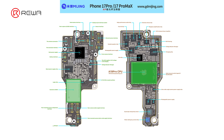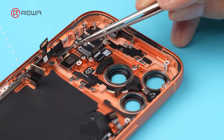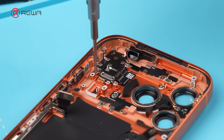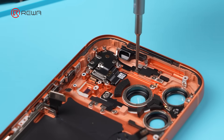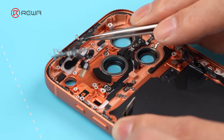The NAND is closer to the A19 Pro chip on the opposite side, with nearly one-third overlapping. This means heating the NAND for storage upgrades might risk damaging the A19 Pro. Remove the LiDAR. Unscrew the antenna module. It seems Apple has used more screws and less adhesive, which could be friendly to repairs.